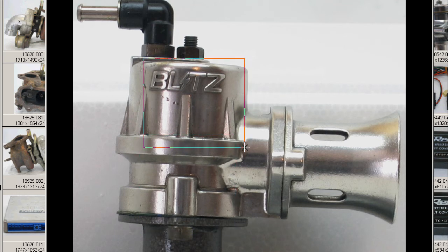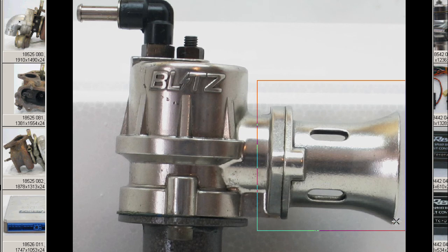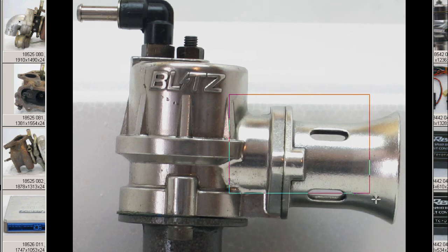There's a piston in this area and a spring in this area. The piston is pushed by boost pressure from below and pulled by intake manifold vacuum from above, and is resisted by the spring. When the intake manifold vacuum and boost pressure are enough to overcome the spring, the piston moves up, releasing boost pressure from the front of the trumpet and giving that distinctive blow-off valve sound.